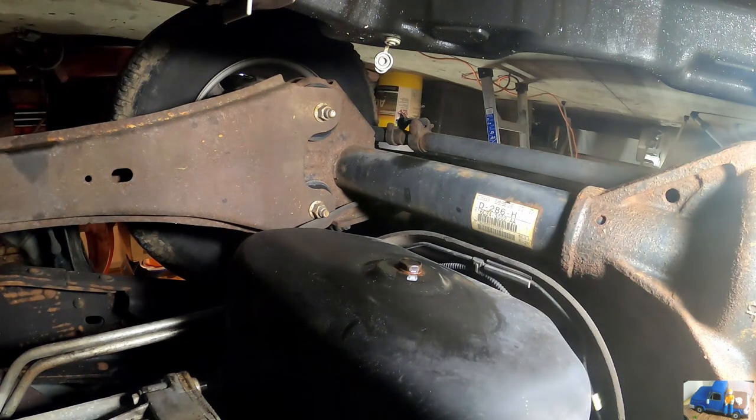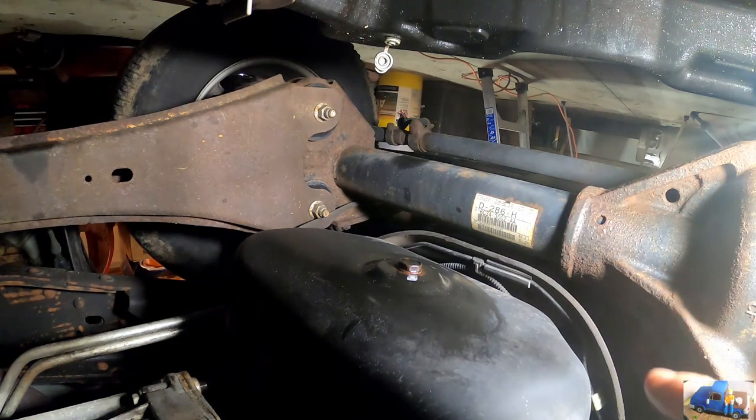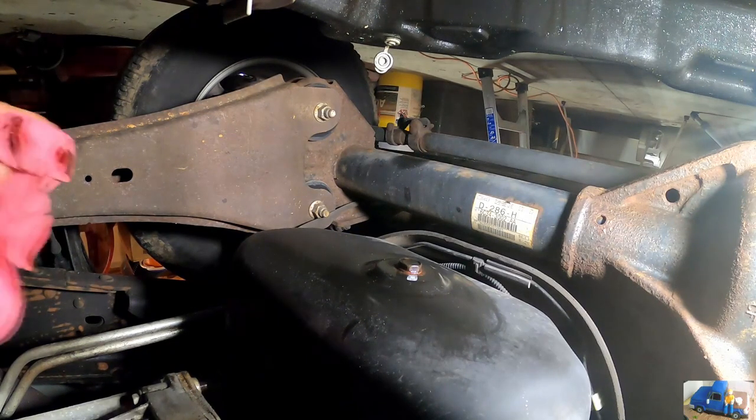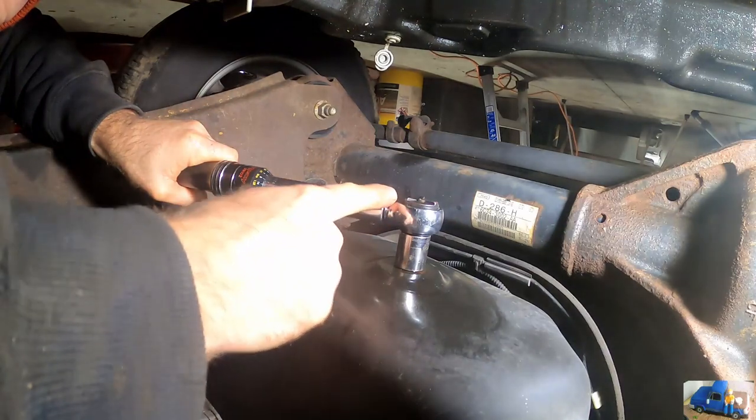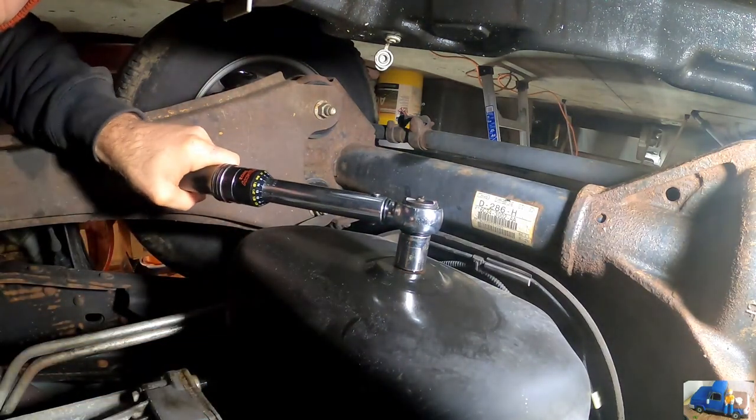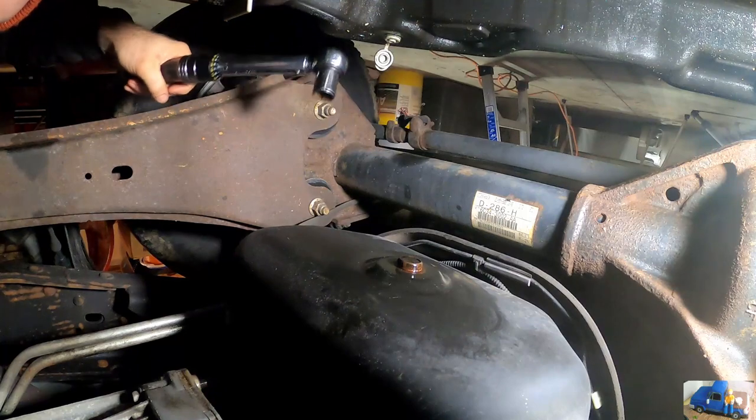This is the only truck that I use a torque wrench on the plug, because I have to get it out for the plastic cap on the oil filter — I don't want to break that plastic cap because I over-tightened it. Ford calls for 18 foot-pounds on this, and I think the cap up there is like 18.5 foot-pounds. Wait for the click where the beam breaks.